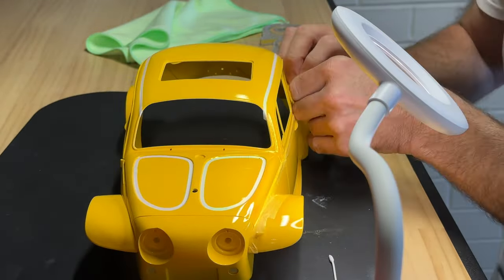I've also recently moved over to using this style of paint, I guess it's more like an oil-based rather than the acrylic, which I've always used in the past. The first time I used it was on the Ford Ranger on the grill, and it adheres really well to the chrome without sanding it back. You also get time for the paint to flow before it dries, and it's not patchy. So I prefer it, so I might start buying that in the future for other bits.